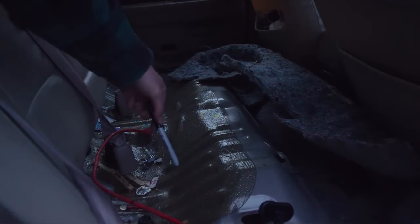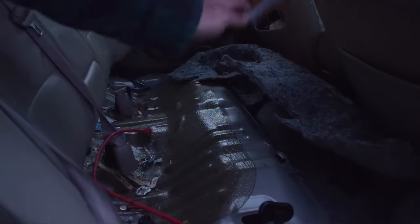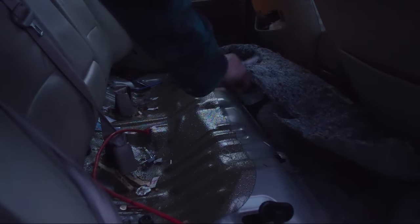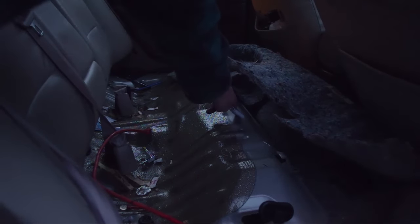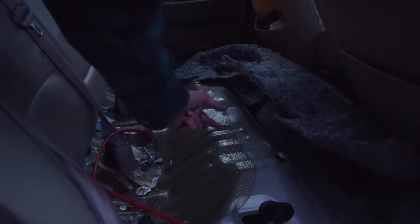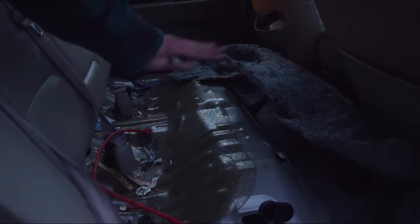After some proper internet sleuthing and some measurement, I found that the area I drew with a sharpie is the area I need to cut out. Now the really, really intensely important part: make sure you only cut through this piece of metal — don't go into the tank that's right below it. Just graze it with your grinder, go real shallow, get to the point where you're almost through it and then punch it through. That way you don't actually go through the tank. You do have like half an inch of room, but don't use it. Stay safe and don't blow yourself up.